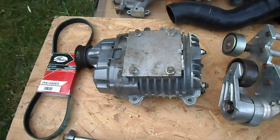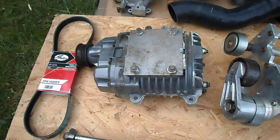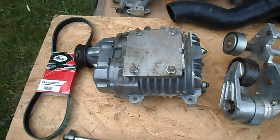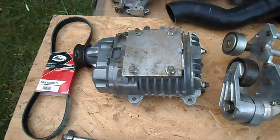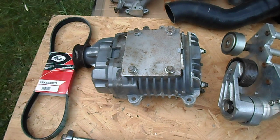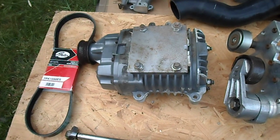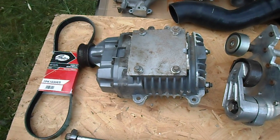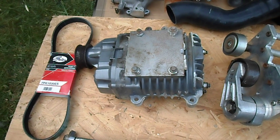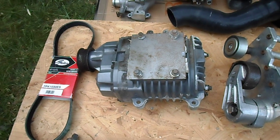I'm using the Jaguar XJR6 bottom pulley, which is a seven and a half inch bottom pulley. I removed the aircon pump V-belt pulley on the Celica Supra bottom pulley and replaced it with the Jaguar one. It's got four little tapped holes in the Toyota pulley so you can use them to mount it. I think it was about two mil machined out and two mil machined off the Jaguar pulley - I'll show you that later on.